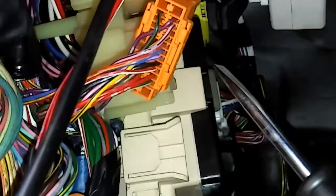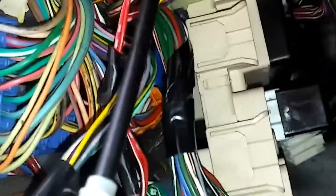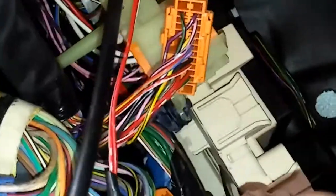It's kind of uncomfortable to get down here. You're underneath the dash on the left-hand side. This box right here is connected with three 10-millimeter bolts — two at the bottom, one at the top. You might want to use a long socket for the top one; it's a lot easier. Just loosen them up and pry this back a little.